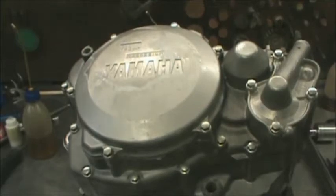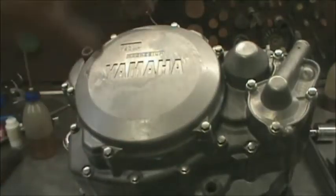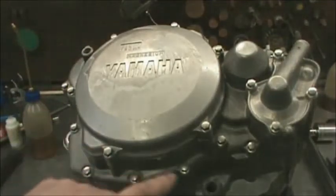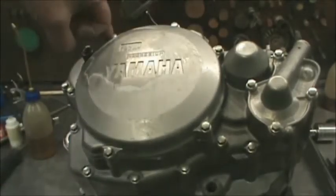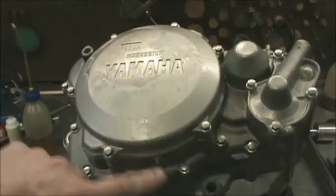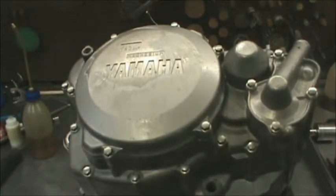I've got all my bolts bottomed out. I'm going to concentrate on the bolts holding down the large clutch cover — the ones that go through to the case. The dummy bolts that don't go through to the case I'm less focused on. I'm going to make a big X pattern, starting from the inside and working my way out, criss-cross, concentrating on bringing the clutch cover down to the center cases. Torque is seven and a half foot-pounds.